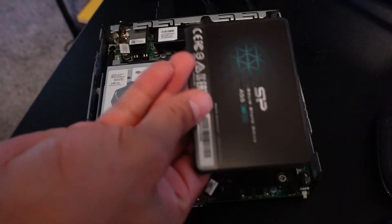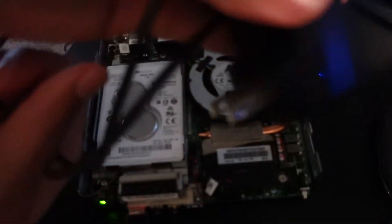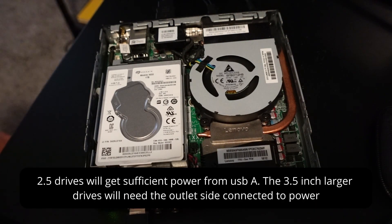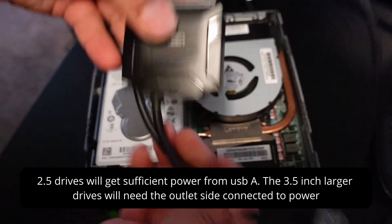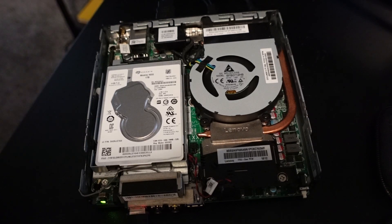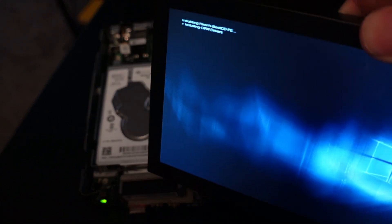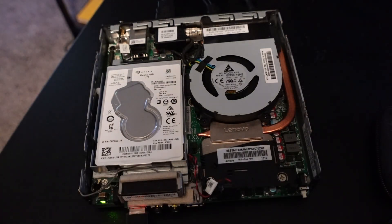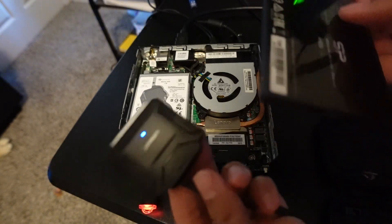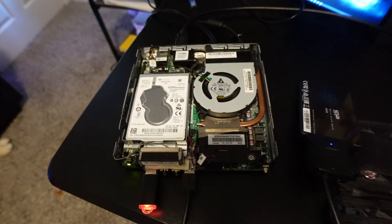This should be the new SSD we're trying to put in. With a 2.5-inch drive you don't need the extra power connector, because it's not 3.5-inch — you can get by with just the adapter and the USB. It's going to get power from the USB because it's 2.5-inch, smaller form factor, and it doesn't use that much energy. It's booting to HiRens. Don't forget to connect your USB-A to the computer, then connect your adapter, so your computer can see the drive.